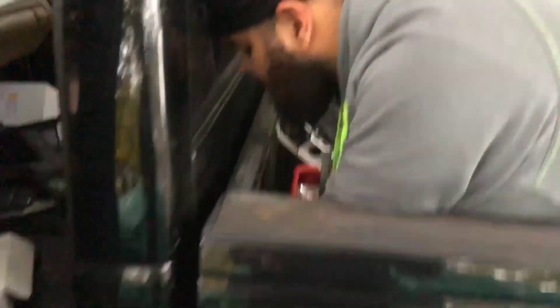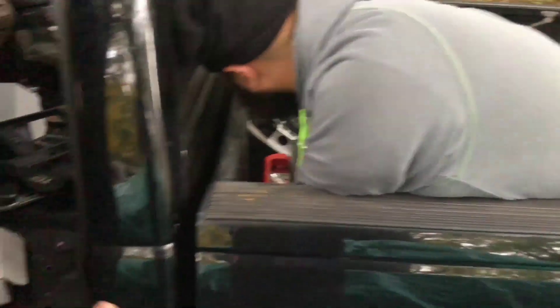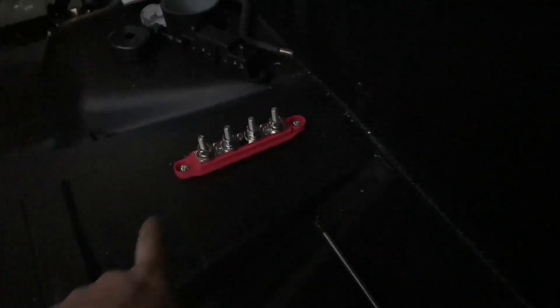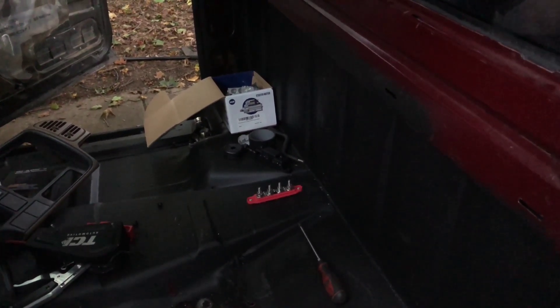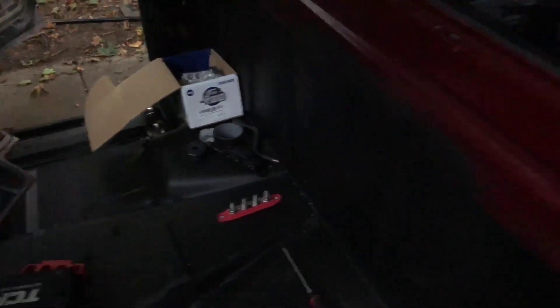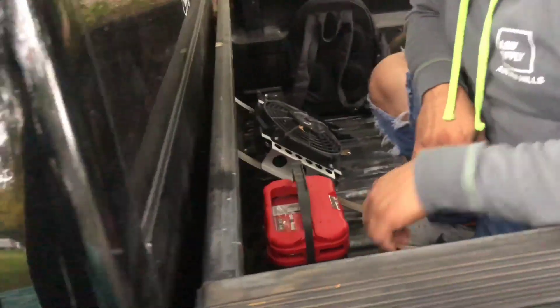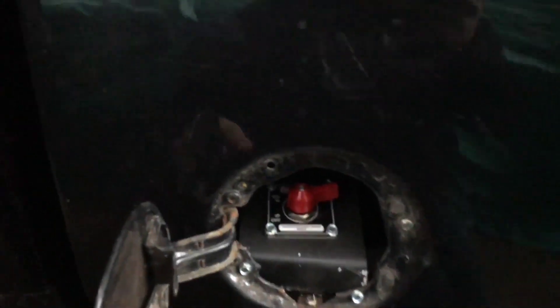So what Ricardo is doing — he's drilling the hole right through his cab so we can run his positive cable to this bar right here, which I'm bolting in right now. That way he can put whatever power source he wants to that bar instead of running it all the way back to the battery. Now for his negative, he's got a kill switch. He's put his kill switch right in here. Pretty clever.